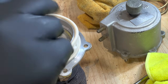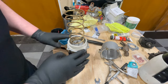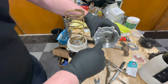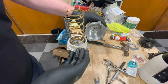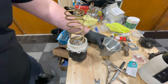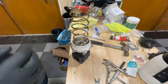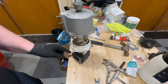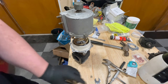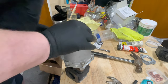The valve drops in there, then the cup, then another washer on the top, then it gets a little lock nut. Now we bend it over, and then the diaphragm can go in. Make sure that the silicon cup is completely over the lip here - the groove in here should clamp on that wider part. If you don't clamp it down properly, you won't have an airtight seal, which means you won't get the valve working. Make sure this fitting is pointing slightly away from the other one. Now I'll have the difficult task of compressing this down and catching one or two of them with a nut so I can bring a clamp in and fully force it down.